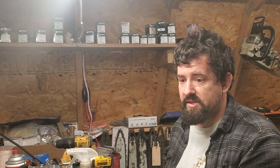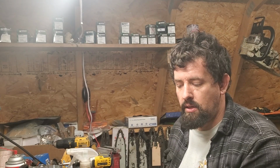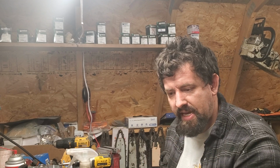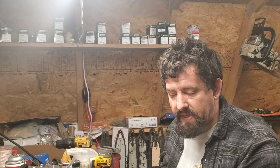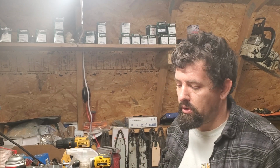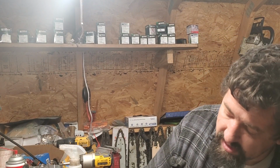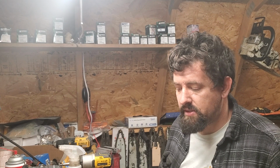We did it with the steel flange through the impulse here, or not the impulse, I'm sorry, through the intake boot. That flange blocks off the impulse hole on the boot here, and it's all sealed up. So no crankshaft seals needed. Steel OEM crankshaft seal still in it.